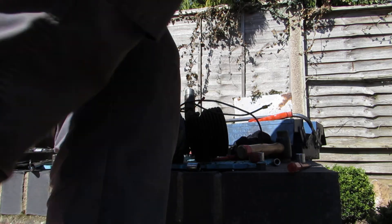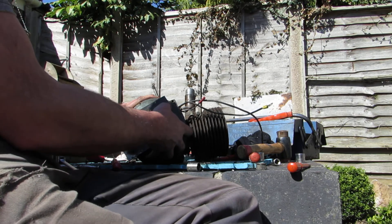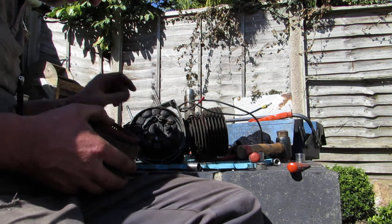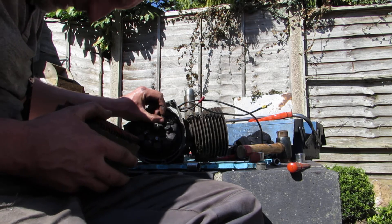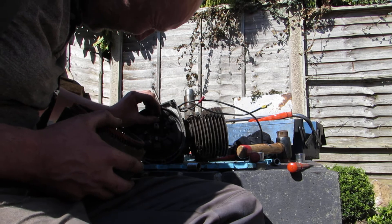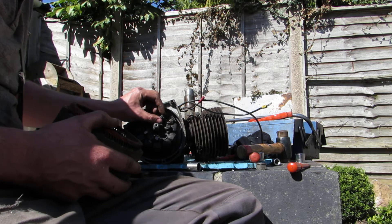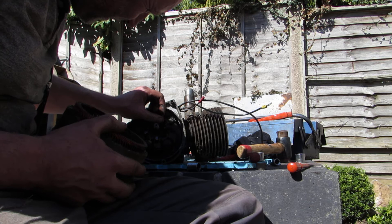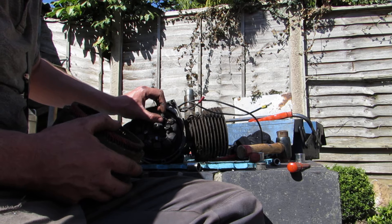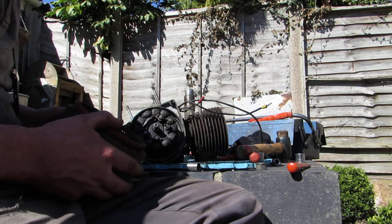That felt good. Let's see what we've got. The brushes are even worn down to the wire - you can see that it's actually down to the wire. It's been running at a funny angle as well, which means it's come out so far the brush holders are no longer captivating it properly and it's cocked over at a funny angle.